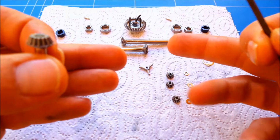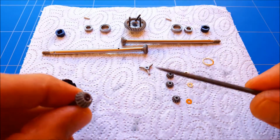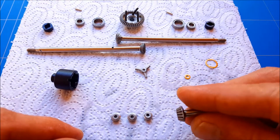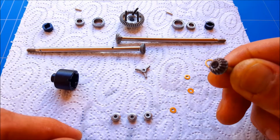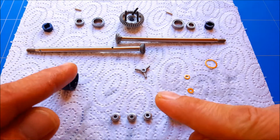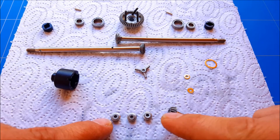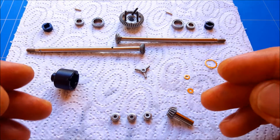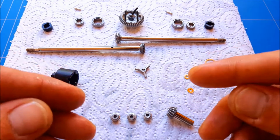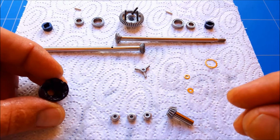But I want to do it away and keep it all clean from any metal grease or metal shavings. So we do this off camera, of course. We shaved off all the last little bits and make them nice and round. And the second reason why we are doing this is because if they break off and are inside the differential, and those little metal parts get in between the teeth, you'll be grinding them off pretty fast, and pretty quick you'll need a new one. So this is just a maintenance check that you have to do all the time.